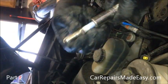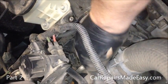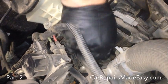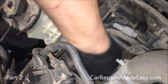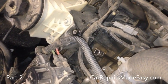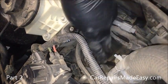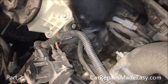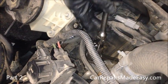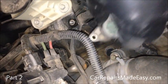Remember all of ours were previously gapped before we started this. We're going right in with the new one. Remember we're doing this on a cold engine — don't ever do it right after you've driven it. We're going to snug her down, get her nice and snug. We're going to set our coil back in.